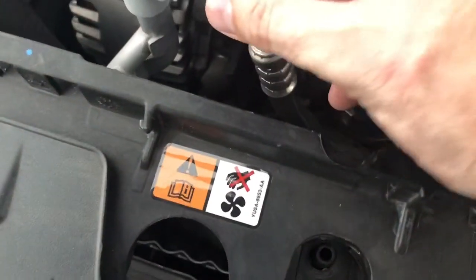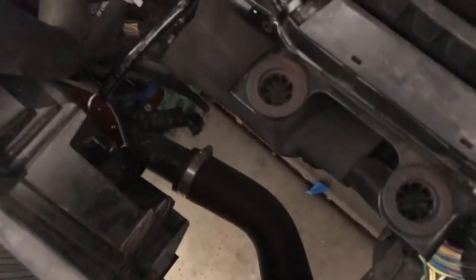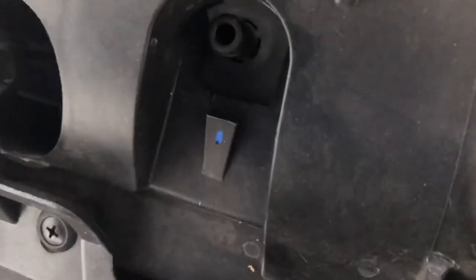Get those tabs off and that allows us some motion there, so now we can probably get that fan shroud out. Removing the fan shroud from the top — I wouldn't say it's a non-starter, but it's definitely more difficult than it's worth. Going to remove the cold side pipe next; I think it's going to come out from the bottom a lot easier. This little plastic shoulder just keeps binding up in here and you just have to fight it more than it's worth. Looks like I may have scored the radiator in the process, so I'm definitely going with a new radiator.